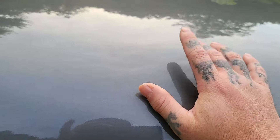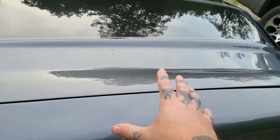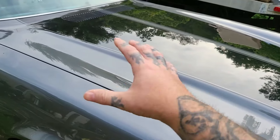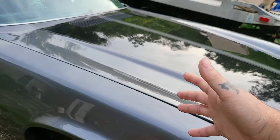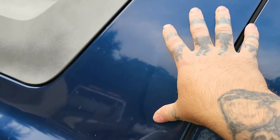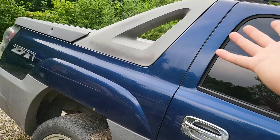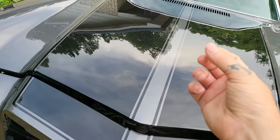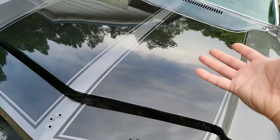The color of this car is shadow gray — that's a Ford color, by the way. Unlike the Mustangs and stuff, it comes in different variances. This is the prime variant. You've got different shades of the color, so if you see a certain color you like and you buy it and it's not exactly the same, you probably looked at a different variant. Because on this truck, this is indigo, and there's a variant with the purple on it that makes the truck look super purple in the sun. When you go buy your paint, go to a place that's got a chip set that's local. See how many variances they've got in the brand of paint and pick the color you like — take it out into the sun.